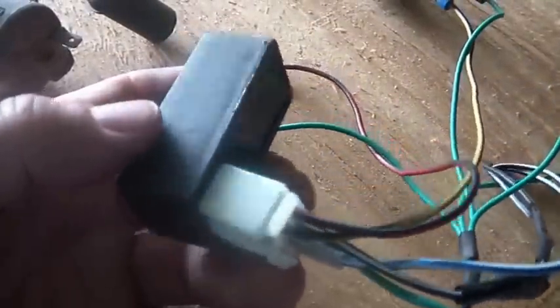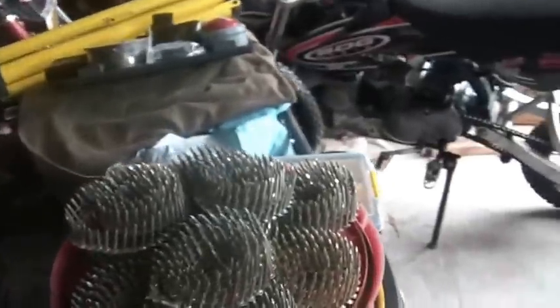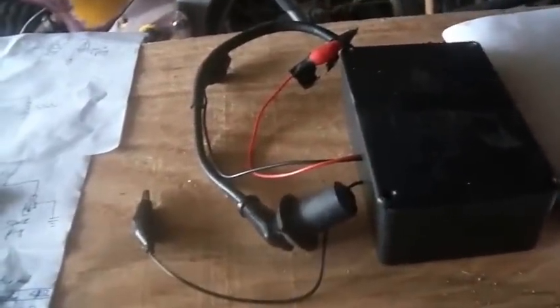So after that, the next generation I came up with was this — a pit bike wiring harness. Your standard 185/200 square plug CDI unit. What you want to do is buy the small CDI unit. This uses the smallest CDI unit. As you look at the various ones, they get bigger and bigger. I lost my bag with the parts, but they do get bigger. What you want is the smallest one for this harness, and for this guy you want the biggest one.